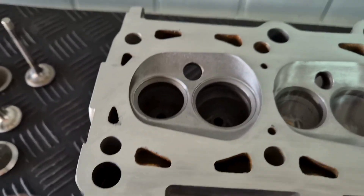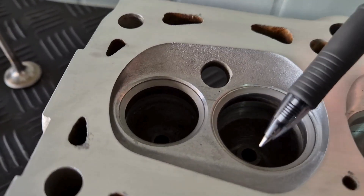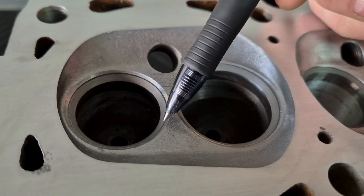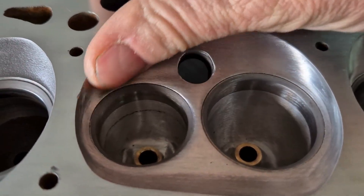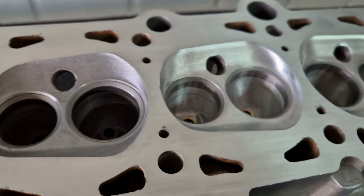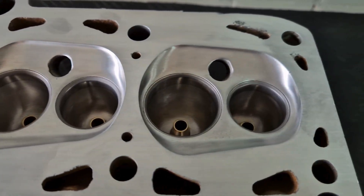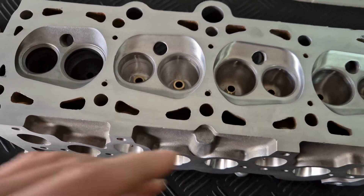Okay, and then your combustion chamber. So that's your standard combustion chamber — you can see all these corners here. This is actually not a bad standard combustion chamber, but sometimes they're horrible, with corners over here and over here. So that's your basic flowed combustion chamber — it's already better, already improved. And then that's your attention to detail — it's a lot higher polish.